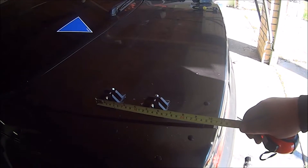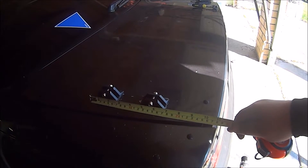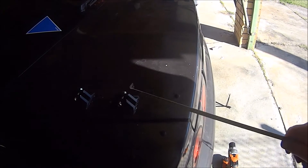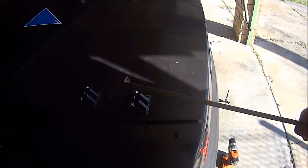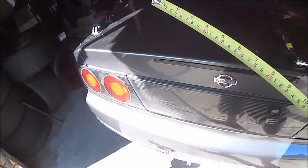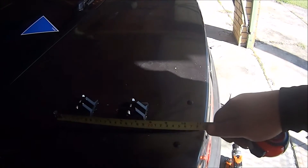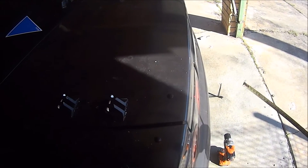What I need is, let's go past here, each side, there's four bits. Probably going to work with two because remember there's a grommet hole just there. This is spanning - which wasn't an issue because the hole went through the second skin and I managed to keep it outside that second skin. But I've got to remove that second skin, so I've got to put a doubler under here. Two will suffice, I don't need one - I was going to put one on the top as well, but I just don't need to.